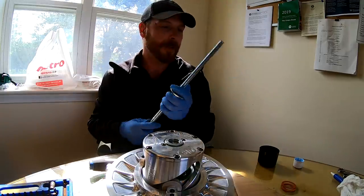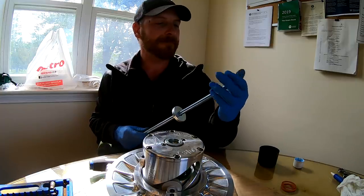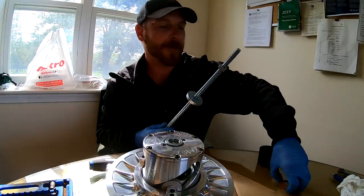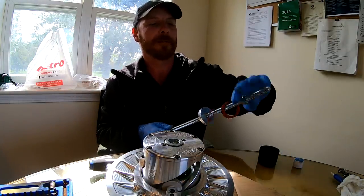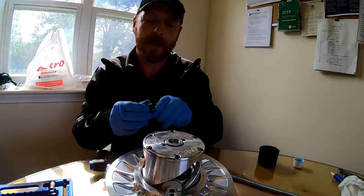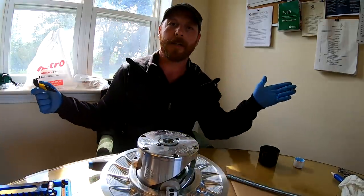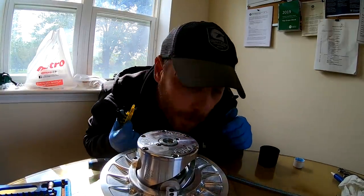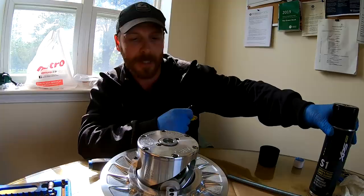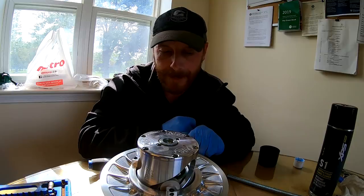Specialty tool — we'll keep that around the shop because we may want to adjust the setup. Easy peasy: ten-buck threaded rod, couple washers, couple nuts, you're good to go. Now we got our shims that I was looking for in the first place. No harm no foul. Let's torque these down, not overdo it. She's good. Belt lash set down to the two shims. We'll give this thing a quick cleaning with the clutch and pulley cleaner from the boys down at the shop, crack the belt housing on the beast, and get her stabbed in there.